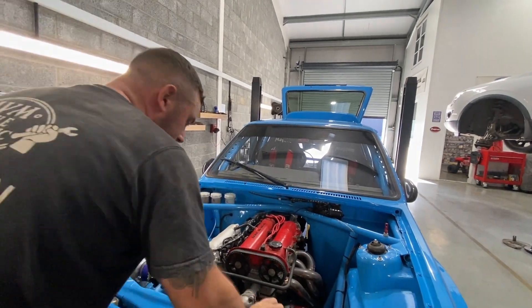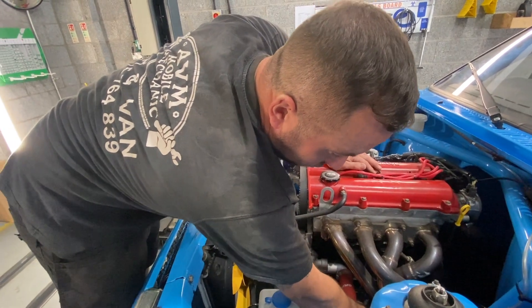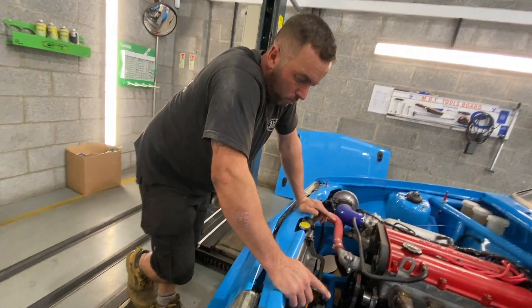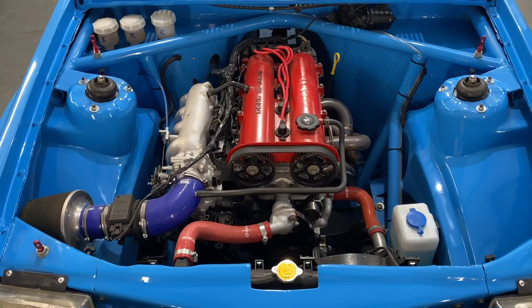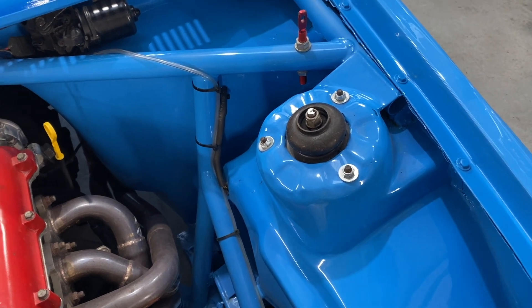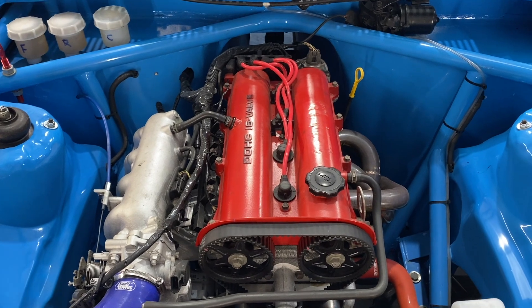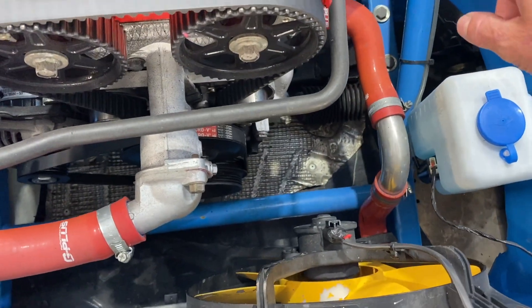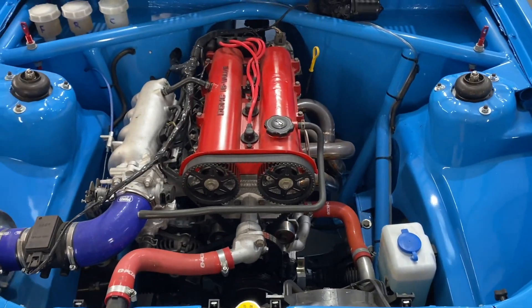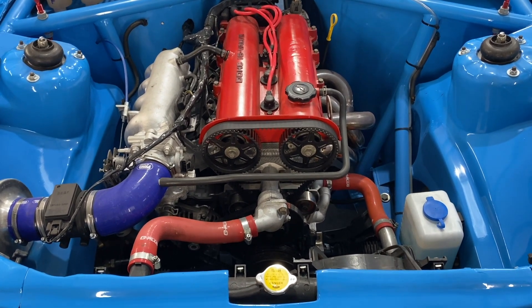To sling the engine right back to get the weight transfer back, he made the top mounts fit Mark 2 Escort. Where the original arms bolt in on a Nova, they fabricated the mounts off the subframe to fit, so the MX5 dropped straight onto it. It's MX5 engine mounts with an Escort World Cup crossmember. The top mounts have been adapted to take Escort Mark II setup, so the front struts are complete Escort Mark II. The bulkhead's been chopped, fully adapted and plated, and the Escort Mark II cradle has been joined into a lovely space-frame setup that ties into the roll cage. The engine is still the original stock 1.8 MX5 — does it need any more? The car is still quite light and the workmanship is absolutely top-notch.